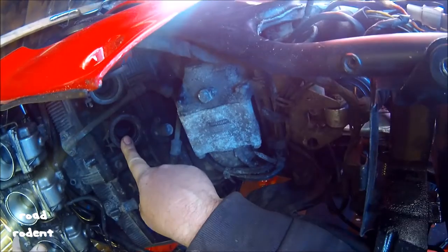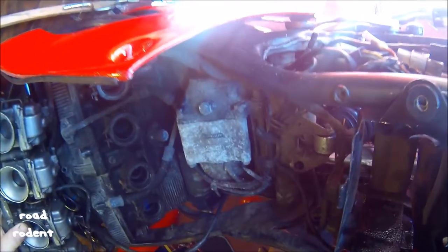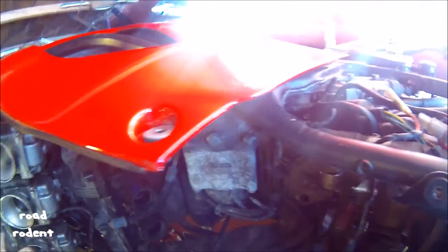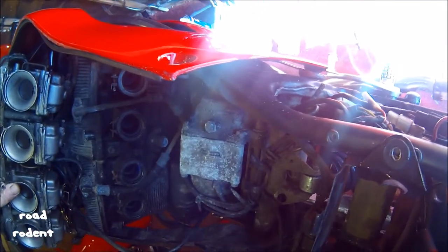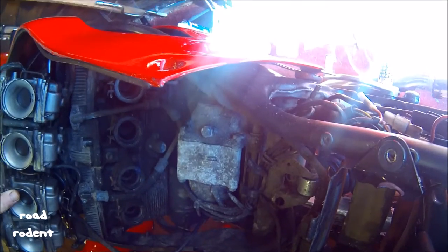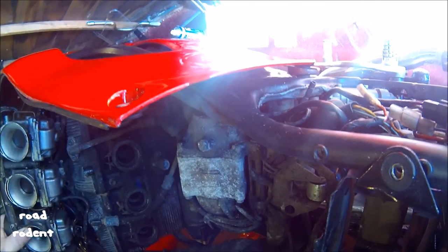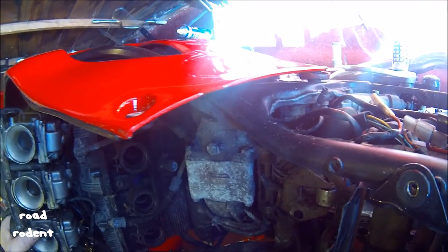Because you cannot compress fluid. So that's what happens with the RX1000, GPZ RX1000, same problem. Only that ends up bending your con rods and snapping your starter chain and stuff like that, ripping the teeth off your main shaft, what your timing chain goes round.